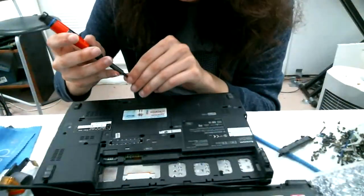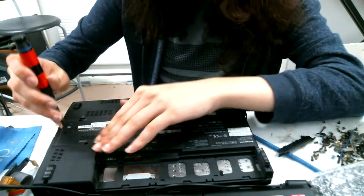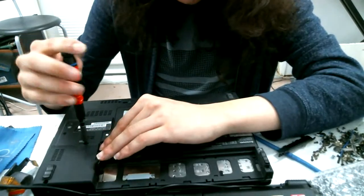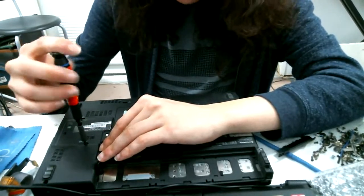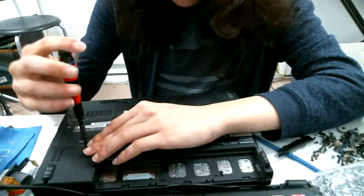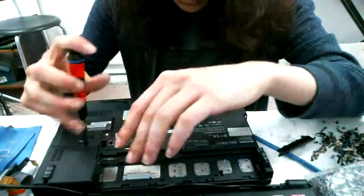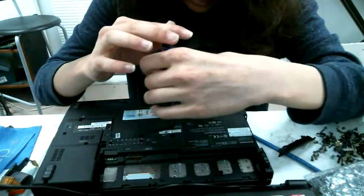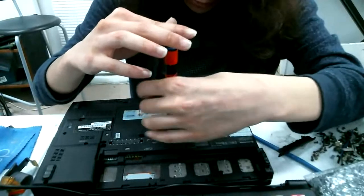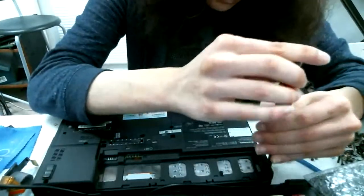MB asks, hi everyone, honest question. Why use libreboot if you can just use coreboot and not include the blobs? Well, in my opinion, it's just kind of easier. And they do have a few extra things they've written, like utilities where I can change the amount of NVRAM and have it be stored in CMOS or something. I don't know. It is kind of not well documented, but the new style of the coreboot wiki is kind of a mess too. It's really up to personal choice.